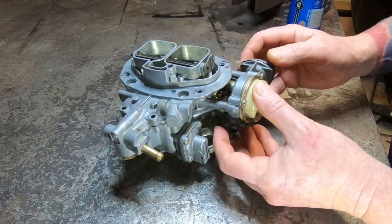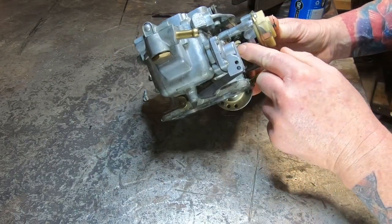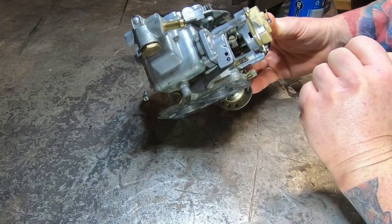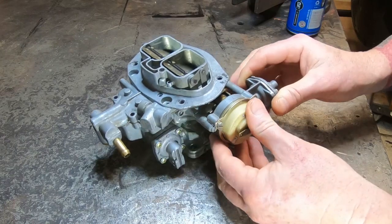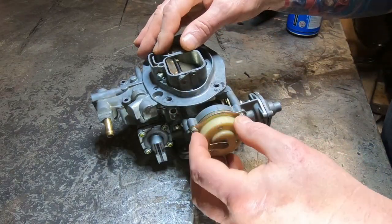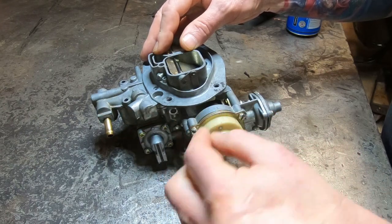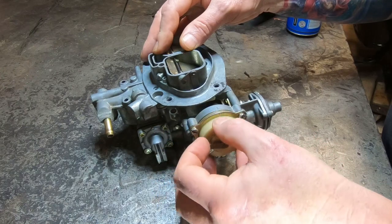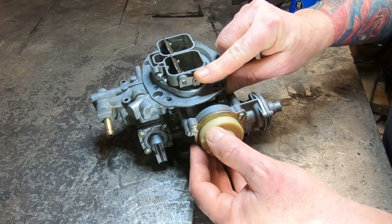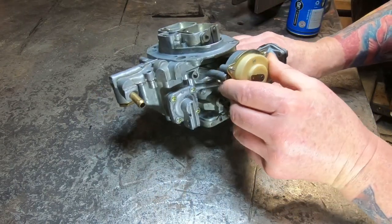When the car is cold, this screw is what's giving it the gas. What happens is there's an electronic bi-metal piece of metal in there, so the 12 volts heats this up, and as it heats up it's gonna draw this open and push this lever up.